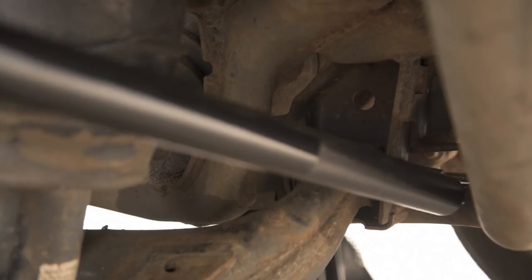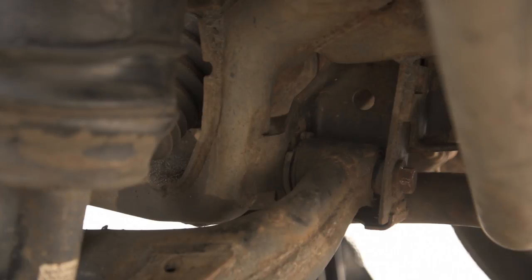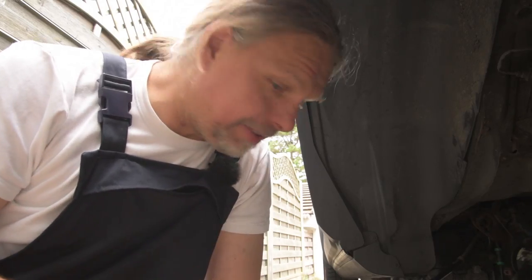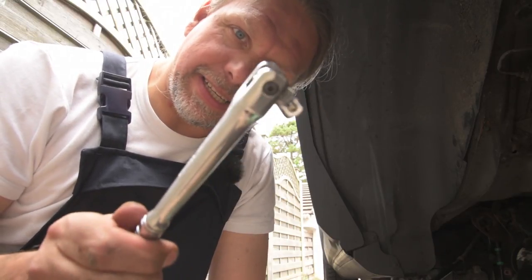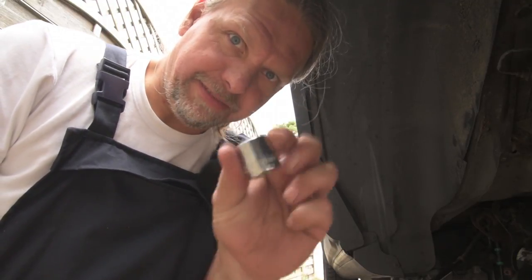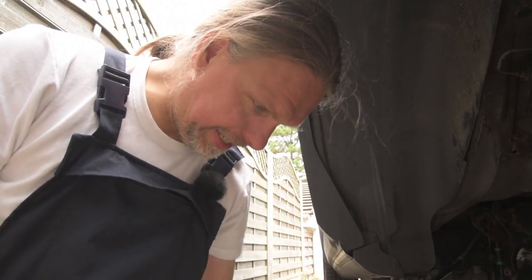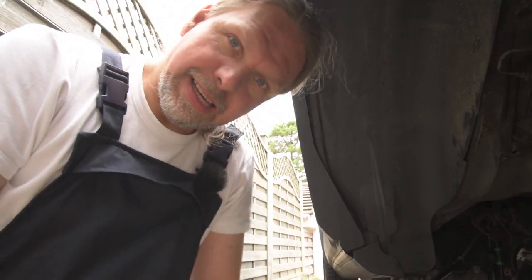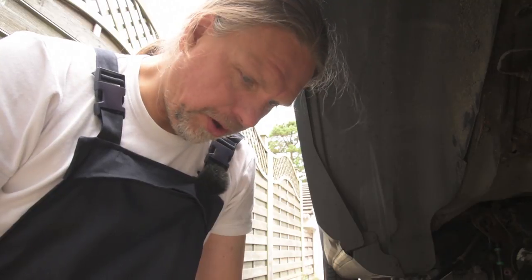With all the excitement of easy bolt removal, my brain decided to take a rest. Right, I am one bolt away from getting this off. And as you've just seen, I have snapped the last remaining 3/8 because it's not strong enough. The reason being, it requires a 21mm socket. As I've explained, I don't have a 21mm half inch socket.